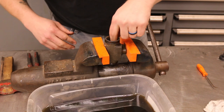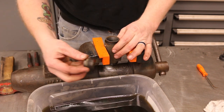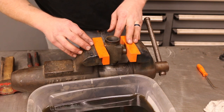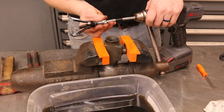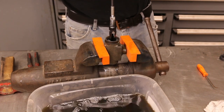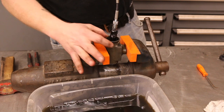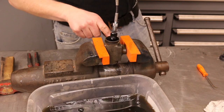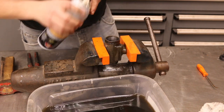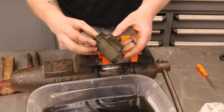After about 15 passes I'm going to take a look with some brake clean. It looks pretty good - there are a couple of possible scoring areas where the plungers were sitting and bound up. I think we'll run that hone a little bit more and we should be good to go. I'm going to tighten the spring to put a little more outward pressure. I'll lube it back up and put it back in. Right here, because there are a couple of little marks I didn't like, I'm going to focus on the center section to keep the outer edges sealed up better and just focus on the bad area.